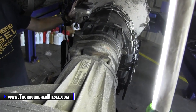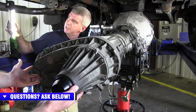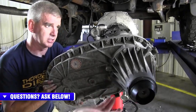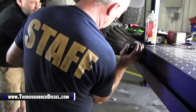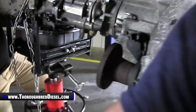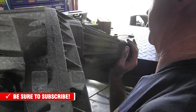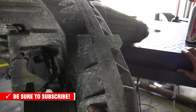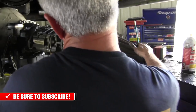Do not leave a transmission on the jack like this overnight — terrible idea. All the weight on the tail shaft housing of your transmission will hurt your core value if you're sending a core in. What you do is turn the assembly to one side or the other and pump the jack up. We're going to jack it up and set this tail shaft housing on a support. Don't hit your head on anything — that's rule number one. Set the tail shaft housing on this so it gives it support, and we're good and safe there.